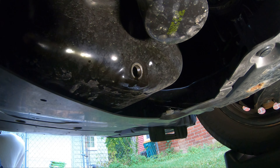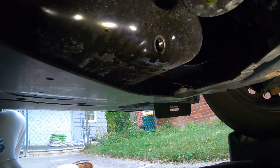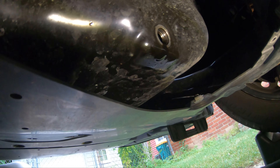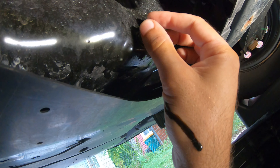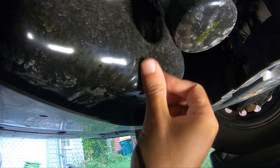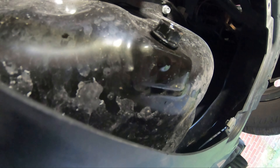We're just about done with our oil drain — just the last few drops are dripping. We're going to put the oil plug back in now, hand tighten it first, and then use the socket to fully tighten. Make sure you kept the washer on there. I like to spread some of the used oil around the oil pan — I believe it helps keep it clean and maybe helps prevent rust.